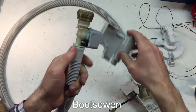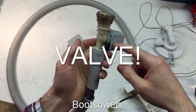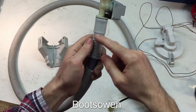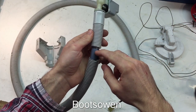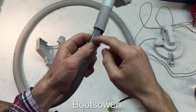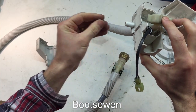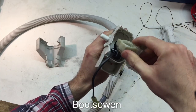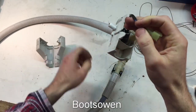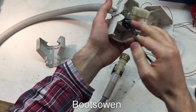I've opened up both covers. On this side here you've got a completely potted solenoid switch, the same as you'd have inside the washing machine but completely sealed. The idea is that if there was a leak anywhere along the hose, the water would flow down through the hose into this box here mounted on the back of the machine, come out here, and then dribble down into that tray we saw earlier. You've got the normal connector to the washing machine, a two-core cable going to the solenoid valve on the other end, and a little piece of ferrite to stop radio interference.